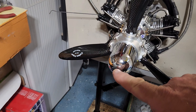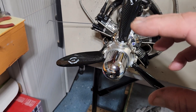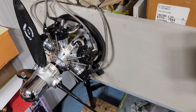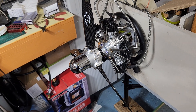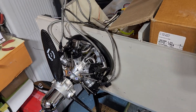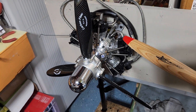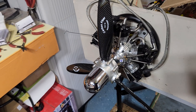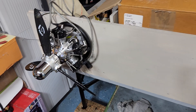I don't have the nut that's threaded on the inside and the outside that holds the center bolt — I had to order it. So that's what it looks like on a 55cc UMS radial engine. I'm breaking that in with just a regular 20 by 8 prop, and then we're going to start spinning it with the 16x10. Actually, I'm going to have it at 16x12 and see how she does.